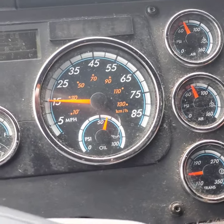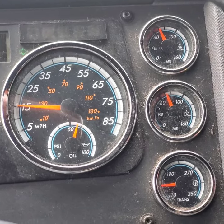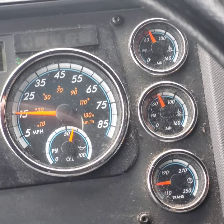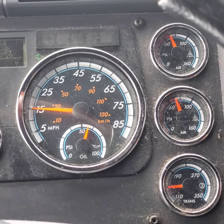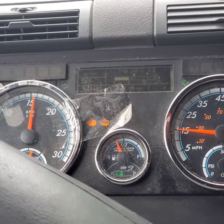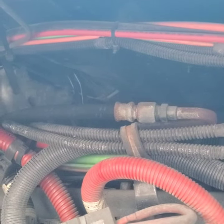Here's the situation: my air is not building up and just staying at 60. Because of that, I am not able to go into high gear and my airbags are not inflating. I'm just trying to get it to the nearest shop to get this problem fixed. This video is linked to my previous video about the air not building up, where I thought the compressor was weak.